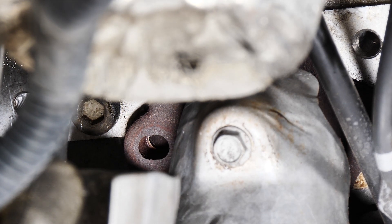What we're going to do today — the correct repair for this job would be to drill that bolt out, tap the thread, clean it all up, and reinstall the new bolt. Sometimes that gets pretty costly, meaning the cylinder head has to come off. This one is very tight back here.